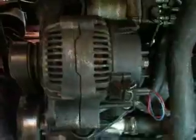Today's little project is non-charging on a Volkswagen T4 camper van. So let's have a look inside the alternator. So what do we do to have a look at it? It's done 170,000 miles, so it's probably going to be the brushes.